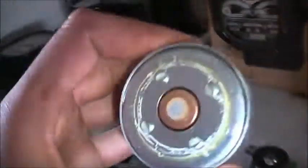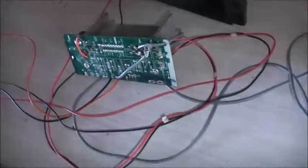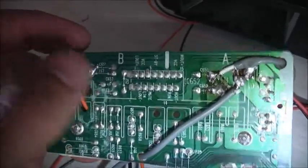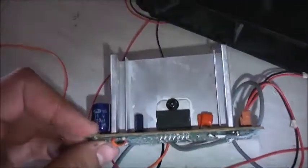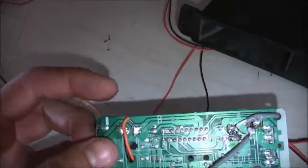It's a bit of a bugger, because these are quite unique speakers. Well, I'll plug the radio in and show you what it's doing. I have to jump — I think I jumped positive. I can't remember which one of the pins I jumped to, but it started to work. I got the right channel mixing in the correct way. But the audio was working, but it was distorted.